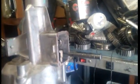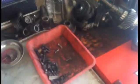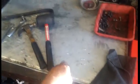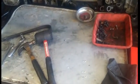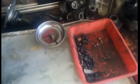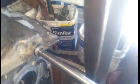Making sure your trans is in neutral, go ahead and drive the punch out — punch the pin out. A little container works really well. If you want to keep your parts organized, I highly suggest an oil drip pan so you can put everything how it goes as you take it apart. A magnetic tray works fine too. Even baby formula containers for you guys with kids. Once you drive that pin out, I would highly suggest you not use your favorite screwdriver — I broke the tip off on mine.